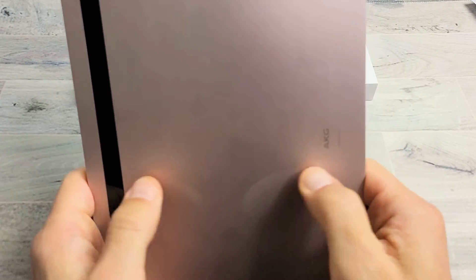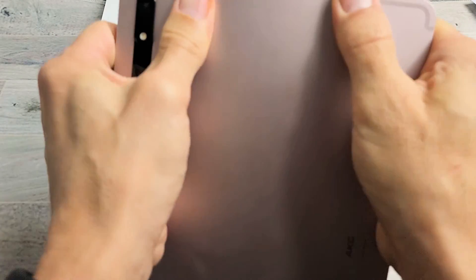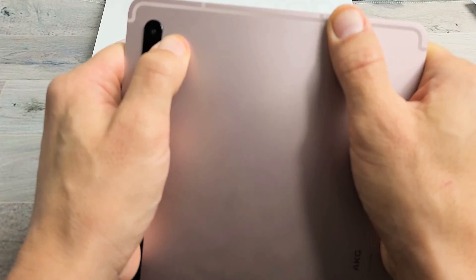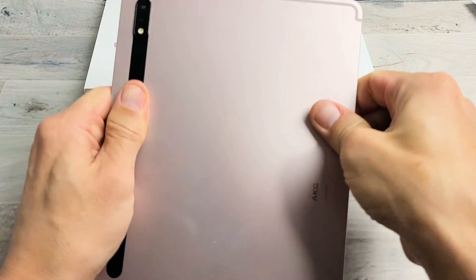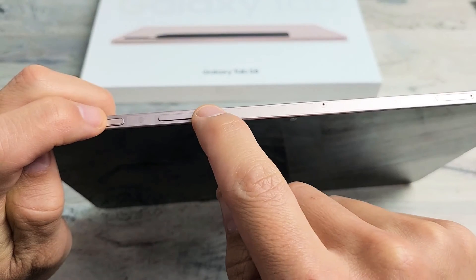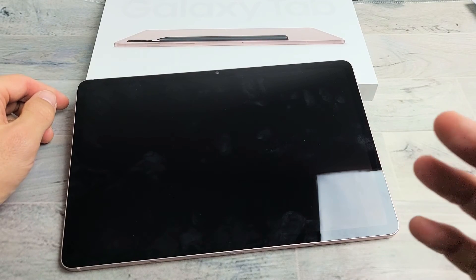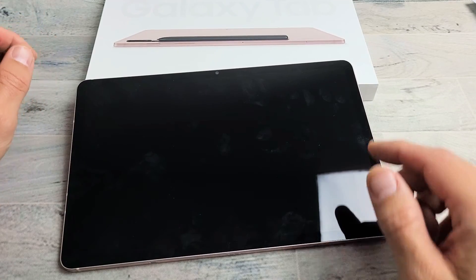Press, press — nice massage all over, even on the camera lens. Sometimes when you're here you might hear a little click — if you do, turn it over and see if your tablet is on. Massage everywhere, on the sides, everywhere. If it's still a black screen, do the force restart again: hold the power button and volume down, press and hold at the same time. Do not let go until you see the Samsung logo appear — usually about 25 to 30 seconds. Hopefully you're up and running now; if not, we're going to the next method.